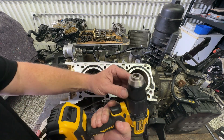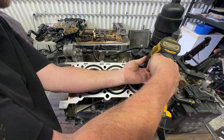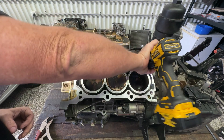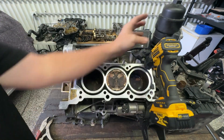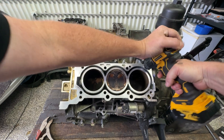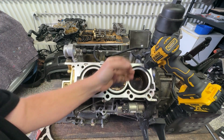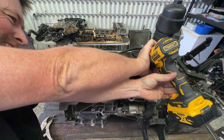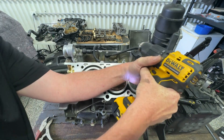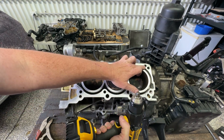I do have a hack for it. I use a drill and I close the jaws right down onto it and tighten that chuck right up. It's a bit awkward with this filter housing here but I've still got it. Then just twist and pull — just make sure that your chuck is actually tight enough. Then we pop it out. If that doesn't work, you're probably going to have to use some sort of a stud remover.